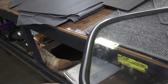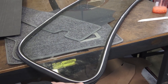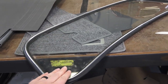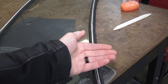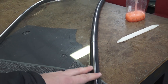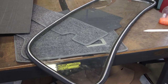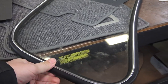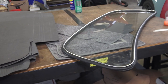Brazilian seals - I've had problems with those. They tend to be harder, not as pliable, not as soft, and very tight going around the glass. I used to have a rubber band effect where at the curvature toward the bottom of the glass the seal would pop off because it was so tight I could strum it. I stay away from Brazilian seals - I go with West Coast Metric or German seals. If you're on a tight budget and want to use Brazilian seals, definitely heat them up and let them sit in the sun to get soft.